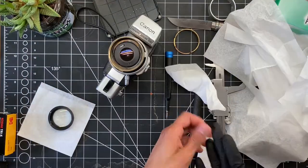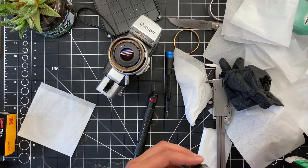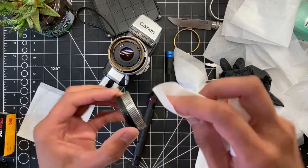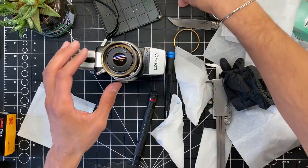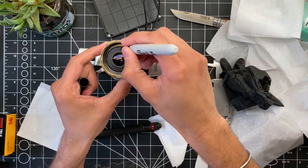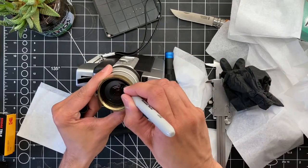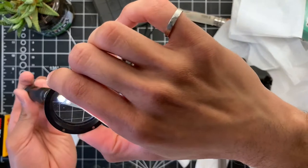With the Super 8 camera having almost no debris, I'm pretty excited. The last thing to do is put this camera together, and one special thing I'm going to do is use some bike chain lube on the outer ring. This lens was very loose when turning it to focus, and I'm hoping this viscous lubricant will help slow it down and make the focusing ring generally nicer to use. I'm evenly spreading it around the outer threads. I almost forgot to put the outer rings in — make sure you've got everything where it needs to be before beginning assembly. I'm also grabbing a Sharpie to fill in a small silver piece on the inner lens — the designers kept the inside of the lenses dark to reduce reflections, refractions, and bouncing of light, so adding black ink to the shiny metal surface is a good idea.